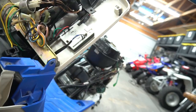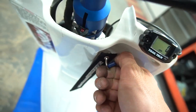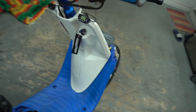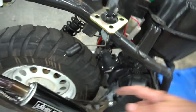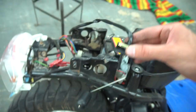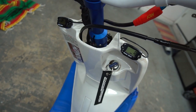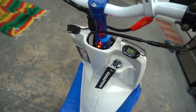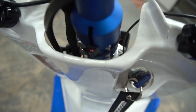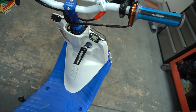Now with everything plugged in, we can plug in the fuel tank sensor and watch this light turn on. If all goes right it should flash - and yeah, it's blinking. Right now it's blinking because the sensor is hanging at its lowest point, simulating an empty tank. If you have gas, the float rises and it should shut off. At a third of a tank the directions say it'll stay steady on. Look how sleek that is, tucked way in there.